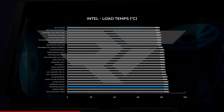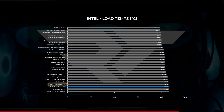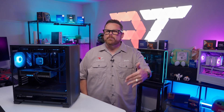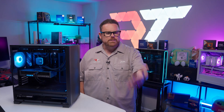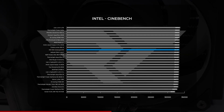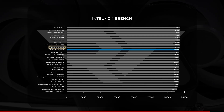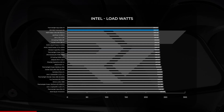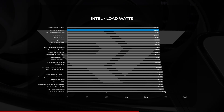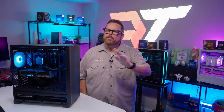Starting with our Intel bench under full CPU load, the MSI MAG CoreLiquid A13 averaged a hair below 86 degrees Celsius. This landed the A13 on the warmer side of our charts, positioning it right in between the ASUS Ryujin III Extreme and the DarkFlash DH360. Not a strong start, but MSI's little AIO actually performed pretty well in Cinebench with a multi-core score of 33,497 — on the upper end of our charts. The CoreLiquid A13 allowed our 14700K to draw just under 233 watts under load — our second lowest power draw average across nearly 30 AIOs.